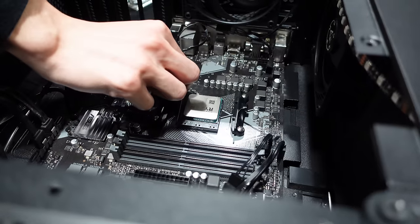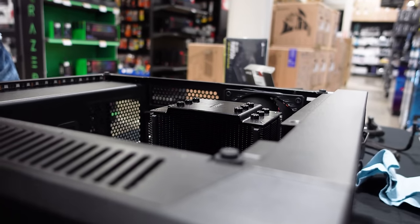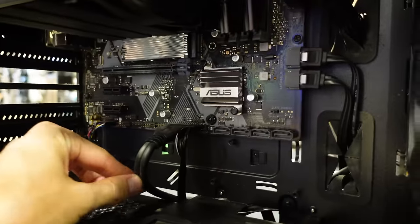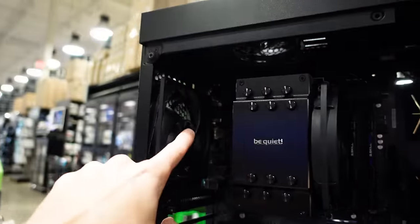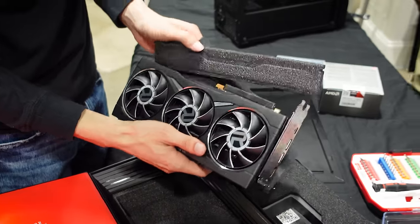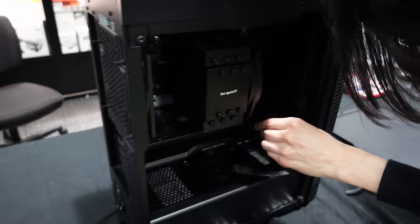Retention arm going down. Like riding a bike, right, Alejandro? Just enough clearance from a high perspective in this case. My patience with these wire clip frames is wearing very thin. We've cleaned up things below, run cables through their channels, got the fans wired in, the cooler set up, the power supply in with its cables — 24-pin and the 8-pin up top. Last up is the 6950XT — that's a good-looking card right there.